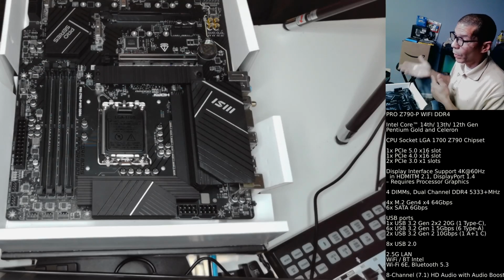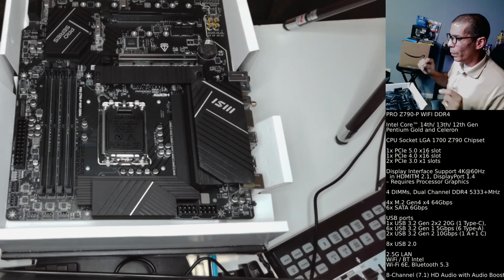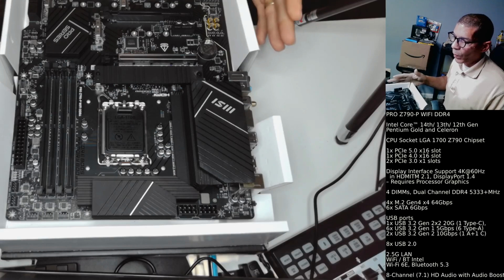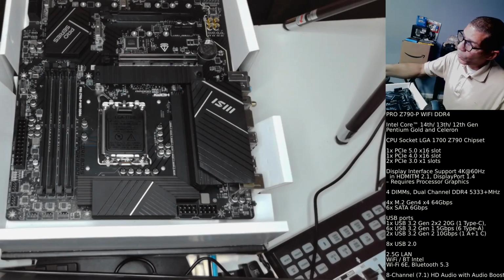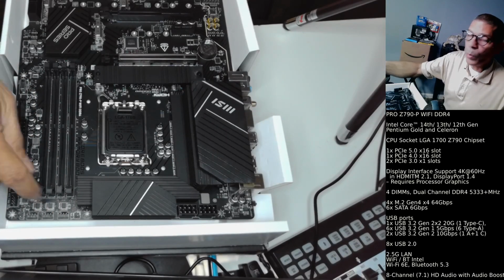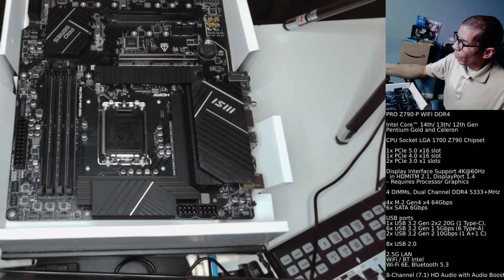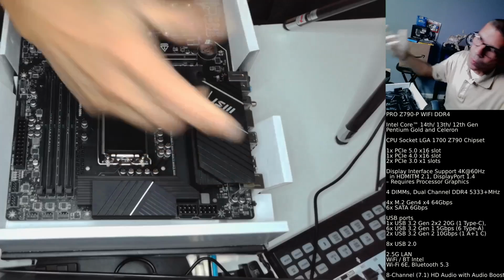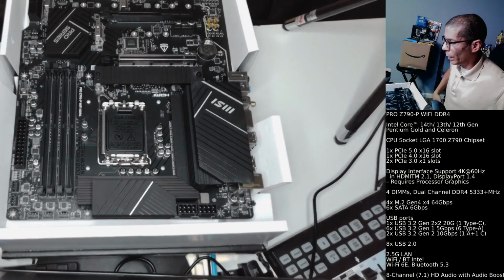And as we saw with that particular case, and most of the cases nowadays, you can actually see inside. So the best thing that you can do, whether it is your trophy computer or display computer, or just simply so that it looks better, is try to fish the cables that pretty much are laid right next to the connector where it's supposed to go. You don't want to have a power cable come out from down here over here, and then you realize, oh, it's on the other side of the motherboard, and you'll be stretching it all across, when you can just simply fish it to the nearest location or opening.